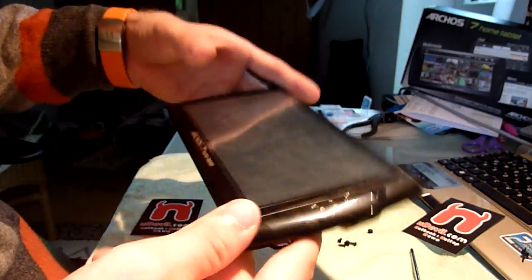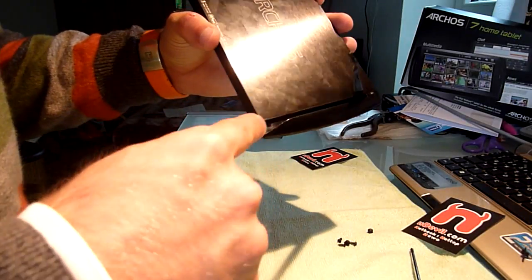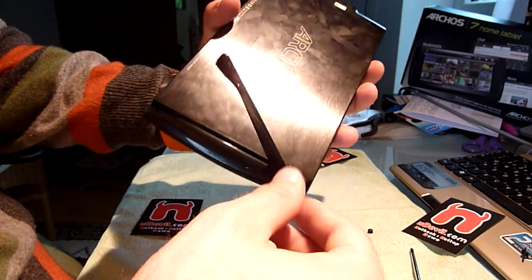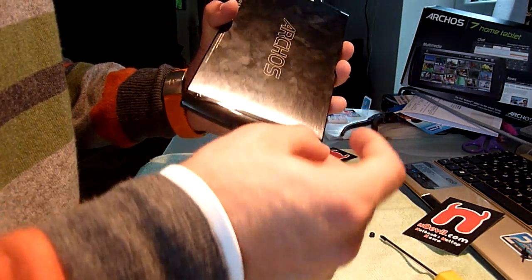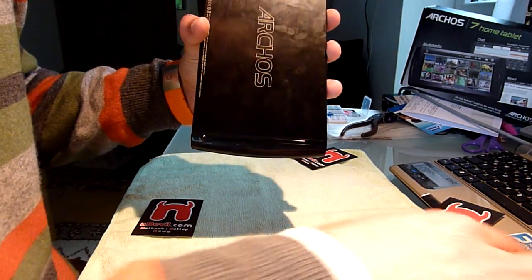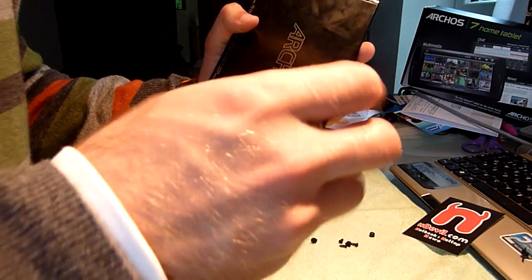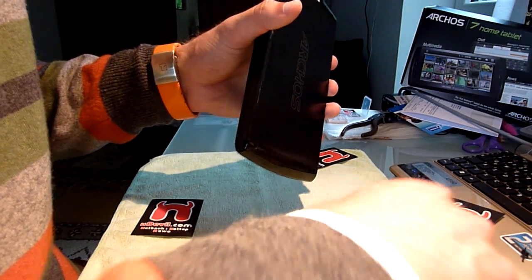Let's start off by popping the leg up and taking out one of these screws. There are another four under the four little rubber feet — you have to take a needle and go under the rubber to take it out, that's the easiest way. You'll need the needle later too. Then there is a regular screw in there. I already took three other screws out and just left this one in for demonstrational purposes, so just unscrew that.